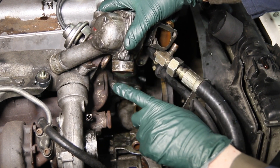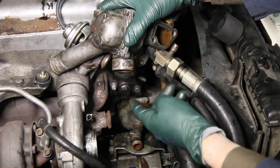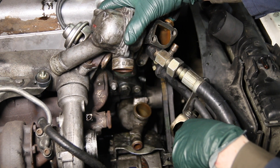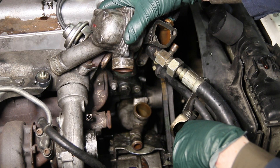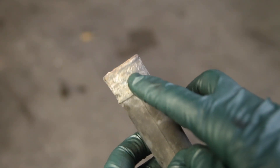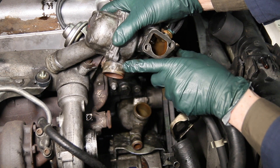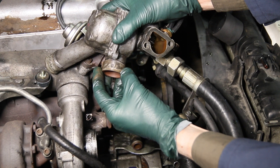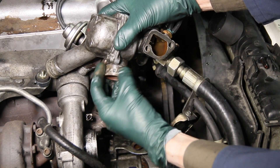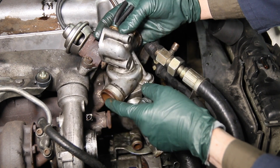There's also evidence of rust in the cooling system. What happened was the previous owner would lose coolant and just throw water in the tank, so eventually the coolant was watered down — that was the case when I drained this engine. That increases corrosion because you're thinning out the coolant. Don't just add water; add 50% coolant and 50% water, or you'll cause internal engine corrosion that keeps eating away at the aluminum. Also, put the clamp close to the edge of the nipple, not on the inside — positioning it inward allows moisture to wick in and corrode the aluminum behind the sealing surface.